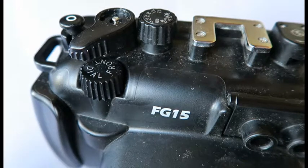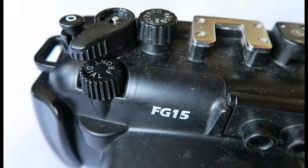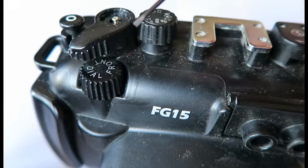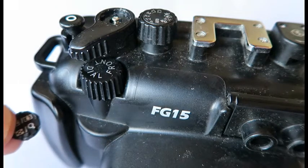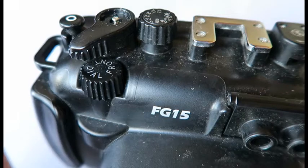And different housings have different functions, but on the zoom cover, it's a small plastic cover like that, which has the icons, and you must use a small, like a jeweler's screwdriver to get in there and just pry it out. It's glued in to a degree, and it's pretty tight, so sometimes you'll actually damage the cover. I mean, damage it aesthetically, but I guess you have to get used to that.